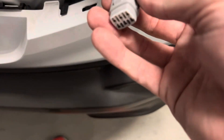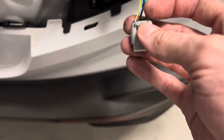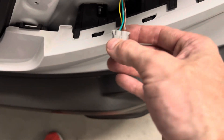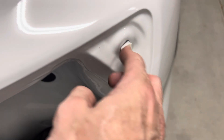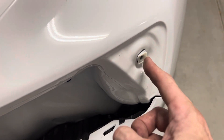We'll pop the connector. This little connector in the tail light assembly is pretty snug. I ended up taking my plastic pry tool, pushing down the tab, and using that little hole in there to hook the end of the pry tool to pull it out. The tab direction is maybe not exactly straight up, but kind of perpendicular to this.